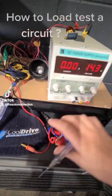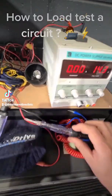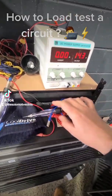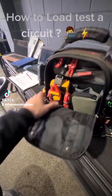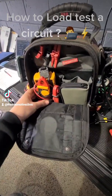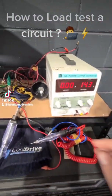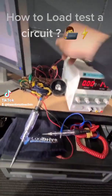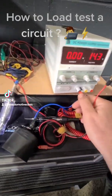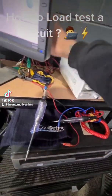Now what could happen if you've got high resistance or a bad circuit — say, going back to your fan circuit — if you use a very small load, a small test light may still light up. It might not be as bright as normal, but you can quite easily pass that off as a good circuit. Same issue with a multimeter: if you hook up an amp clamp or voltmeter to a circuit with high resistance, you'll still read 14.3 volts, and the test light may still light. But if you test that circuit with the appropriate current — six amps plus — it wouldn't light that headlight globe brightly, or it wouldn't light at all. That's why we load test.